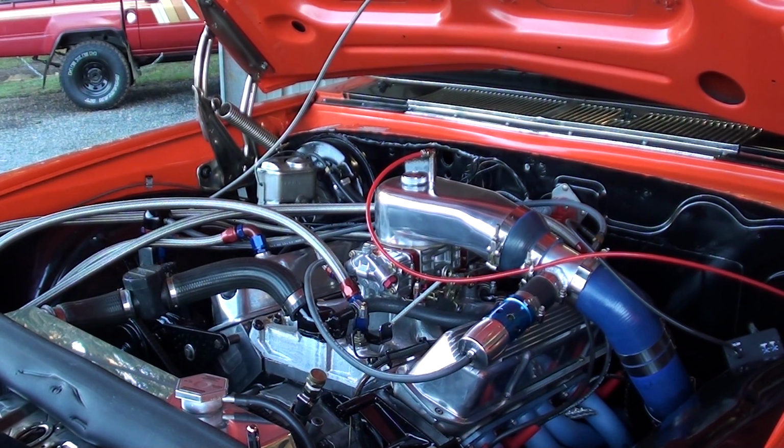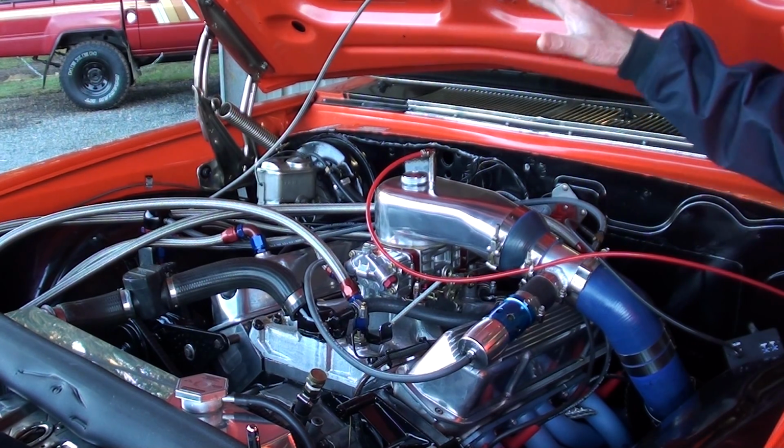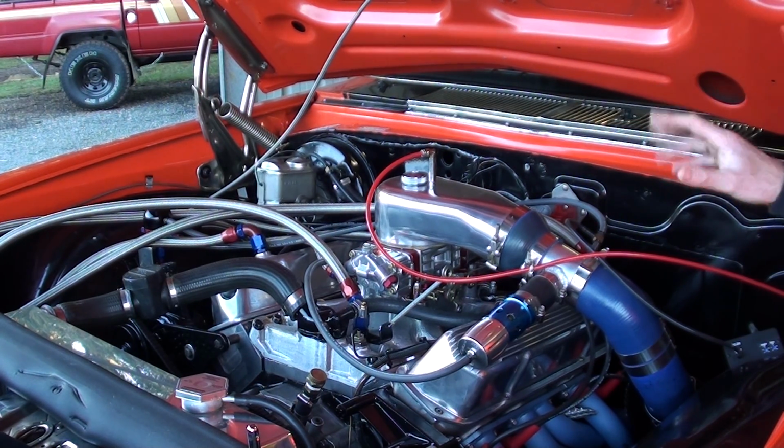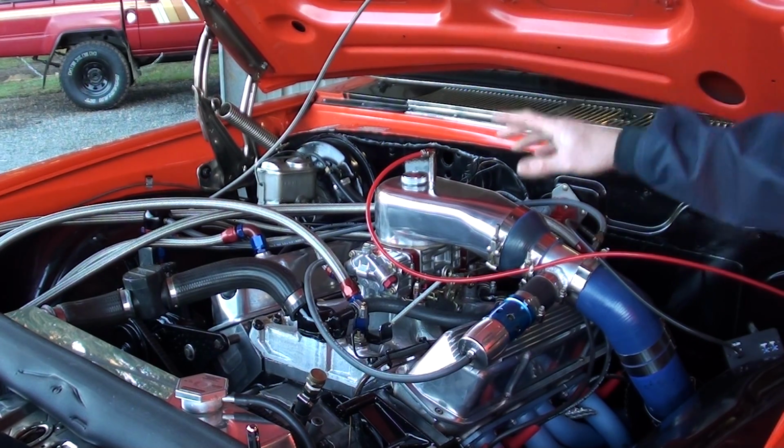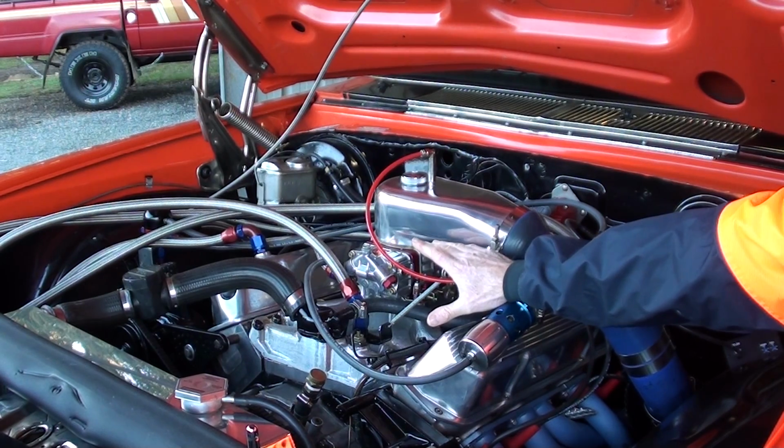Now, the most important thing for setting up a blow-through carb is fuel delivery and boost signal, so getting good delivery when the boost starts to ramp. Now for me, I ended up setting the base pressure, sorry, not the boost, the base pressure for the fuel as high as I could get it.